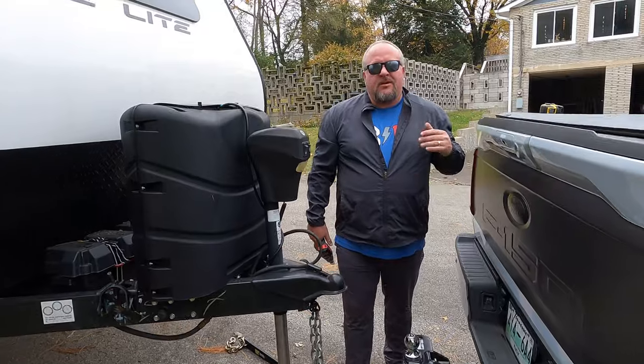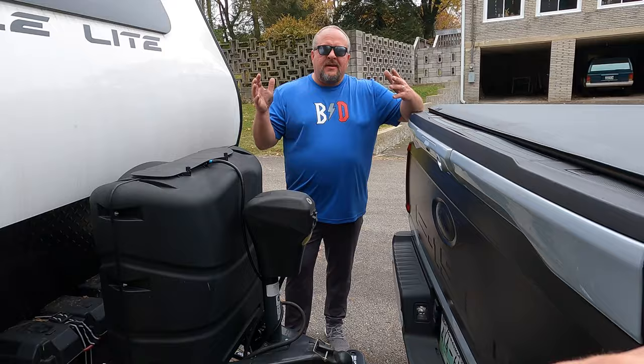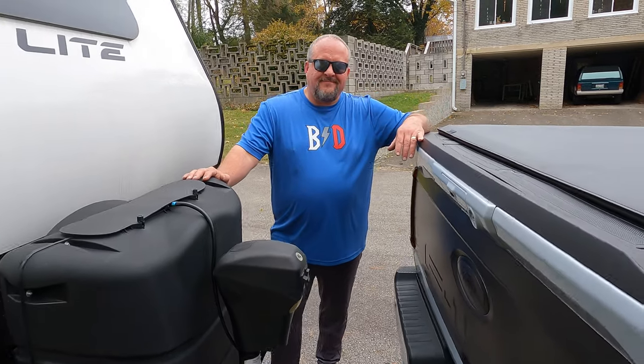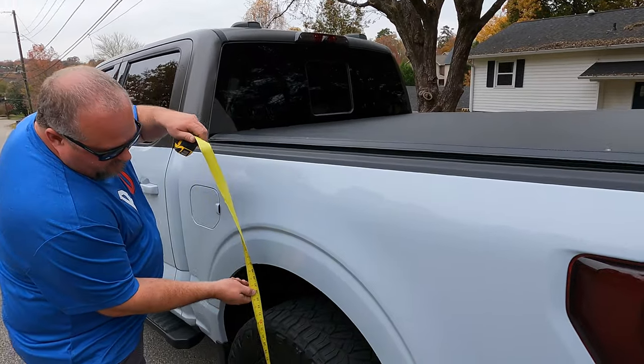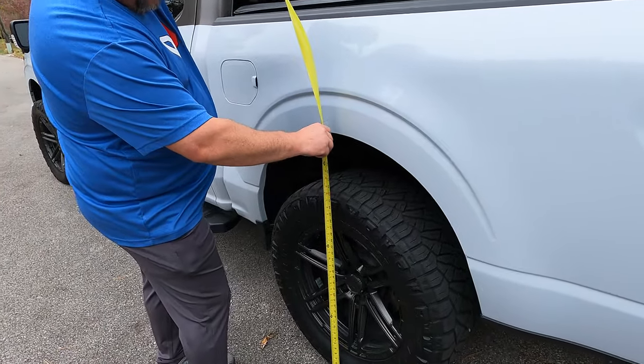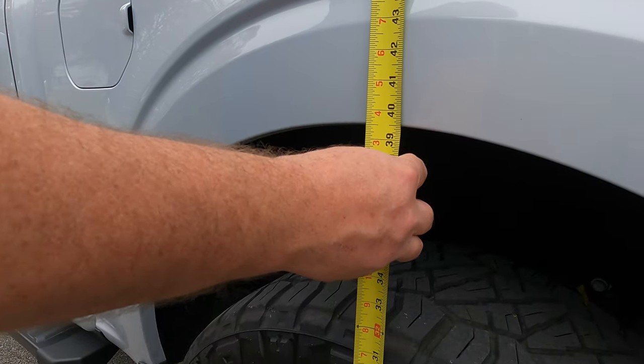I do want to mention while Sam hooks this up — today's video is sponsored by Roadmaster Active Suspension, but we don't take sponsorships from companies that we don't 110% believe in and actually use the products ourselves. We're all hooked up — daggum, they couldn't even hit that subscribe and like button that fast. So what did we actually squat when we hooked up? We're just over 39 and a half inches. So with a 6,200 pound camper hooked up, we had a little less than two inches of squat. That's great!